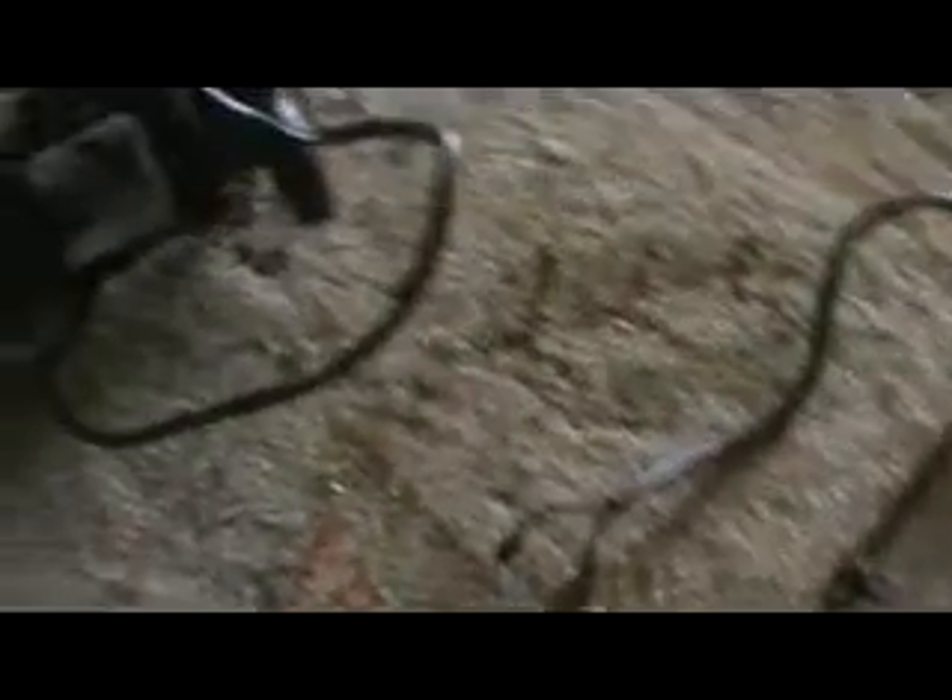This is for the 89 Honda Accord. I've got to use one I pulled from a salvage yard — this is from another one. This one has the igniter on it; this other one is just the plate. What I'm going to do is swap this with this and just see if it's the igniter. If I put it back on and everything works fine, then it's the igniter. It's good to have spare parts — just a little helpful tip.